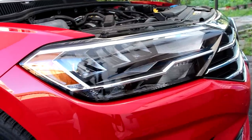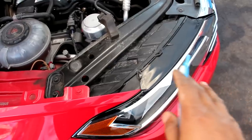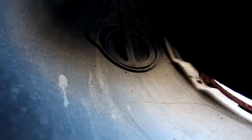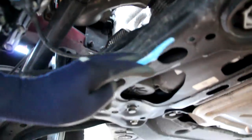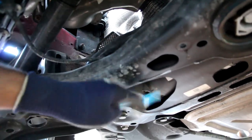Now the headlight design on the Jetta is fairly generic but there is quite a lot of complexity that goes into designing this LED light. If we take a look at the top you can see that there's an individual surface-mounted LED that points downward onto the reflector and that's going to point outward to give you your headlight. This headlight design is actually pretty chunky — it goes back quite far where we have this connection for the LED lights. Coming from the underside if you look at the wheel well you can see that there is an access panel to change the incandescent bulbs that may burn out. Taking a look at the steering setup on the Volkswagen Jetta, the steering rack is mounted just above the subframe but just below that hot exhaust pipe — and that's not great because you've also got the electric motor mounted down underneath here, exposed to the elements and also the heat of the exhaust, so that's not going to be good for reliability.